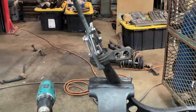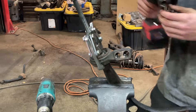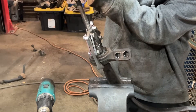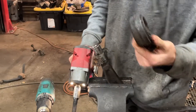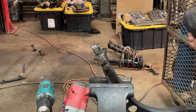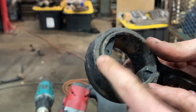The best way I find to take these bushings out is just use a two-jaw puller with a 17 socket on it — that way you can just pop it out. Once that's out, all you have to do is pop this metal ring off the edge. Usually just cut it, or if you put it in a press you can just press it out.